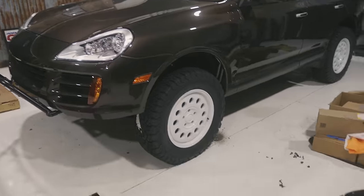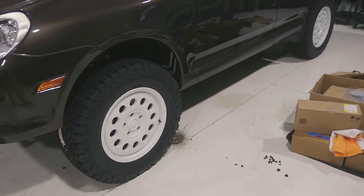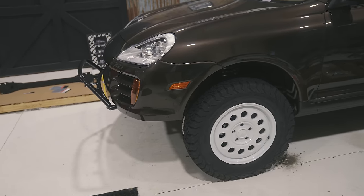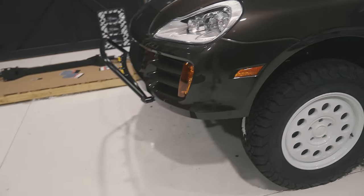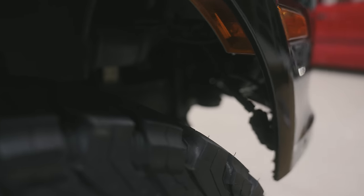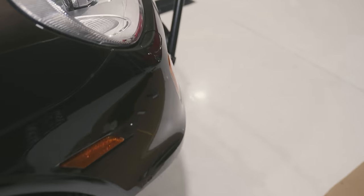They'll do that. Then I'll probably throw those back in, probably when I'm doing the rear bumper, as well as I have to cut it, of course, because it used to hang about a foot lower. So I'll put it in, mock it up with tape, and we'll just Dremel it across, cut a section out, so you still have pretty much full protection from the elements behind the bumper, because there's quite a bit of wiring up there. So it'll protect all that stuff and leave it looking as OEM as possible, which is exactly what we want.